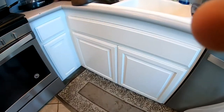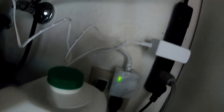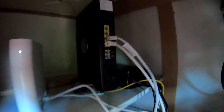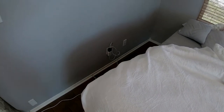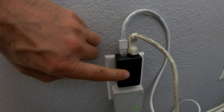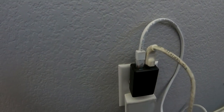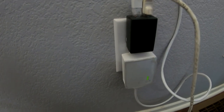Here's my physical setup. The cable company put the modem underneath the kitchen sink — the worst possible place for accessibility. Here's the powerline ethernet adapter and here's the cable modem. Now upstairs, here's the plug, the ethernet powerline adapter, the PoE injector to power and add the internet network connection to the antenna. The other network cable loops into the powerline ethernet adapter, and the network cable goes direct to the antenna.